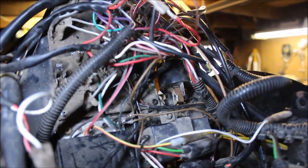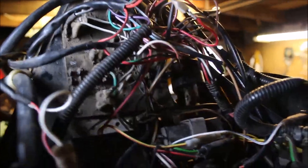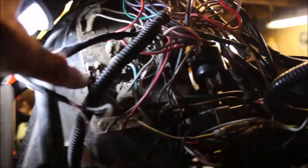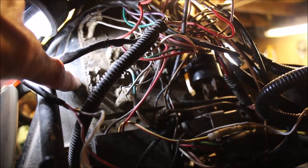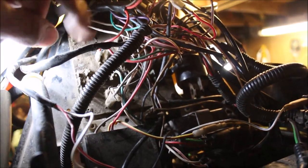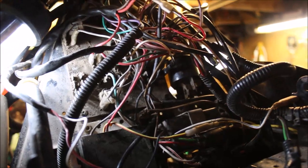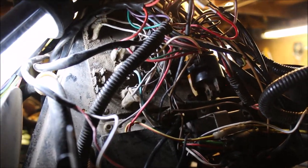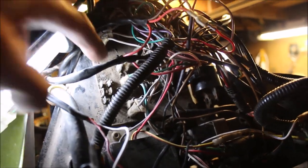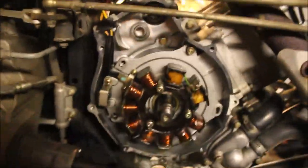So the next time you see this thing, I'll have everything grounded at the coil instead of on the rev limiter. I'm thinking right up here, I might find a way to ground this to the frame, so I've got a good ground for the other black wires that go to it, instead of putting it in that side panel. Or I might just leave them there — I could do both. But I kind of like to leave everything original, so I might try to ground that out.